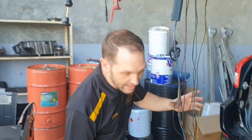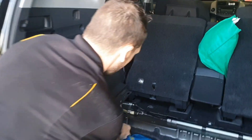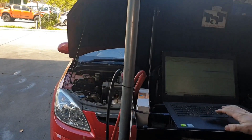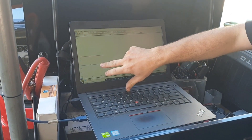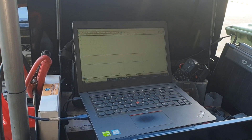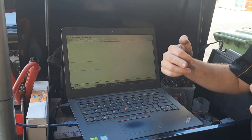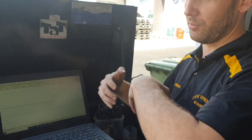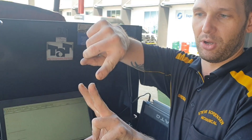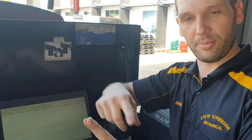Now let's go to the suspected dead sensor. I'm going to plug the scope in just the same as I did on the good one. We should at least see 10 volts if the module hasn't failed — and we've got negative 10 volts, so the module is outputting fine. But when I spin the wheel, not an iota — nothing happening. Because I've back-probed in, I can see the 10 volts from the module coming through, so I know the two wires and the module are good. It has to be the sensor that's bad.